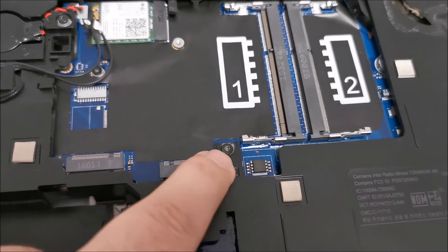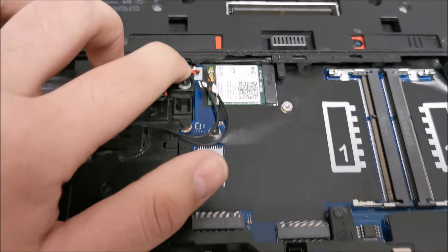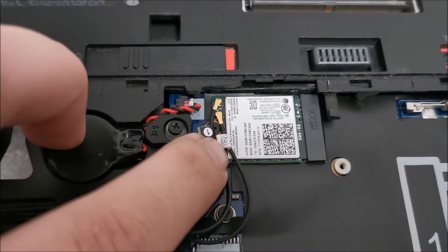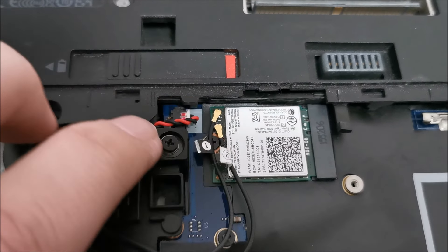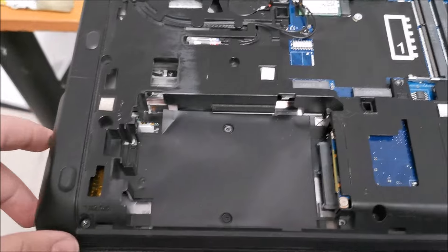The huge ones are from the keyboard but normally they are captive — they don't come out, so you shouldn't have issues with those. The connectors also have numbering on them and you can find the numbering also on the board. So make sure you plug the connectors via those numbers, not in any other order. These two are short — four millimeters, even smaller diameter. The rest I think are from the screen. I hope I don't see any missing. There might be one spot where a six millimeter should go that I don't have — either I put a six millimeter somewhere where a four millimeter was enough, or one was missing from the start. I was not the first to open up this particular laptop, that's for sure.